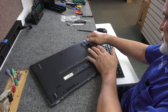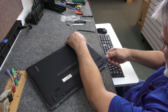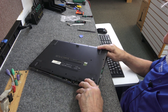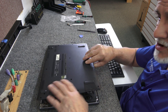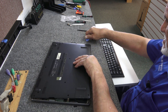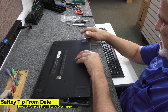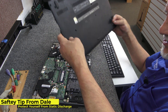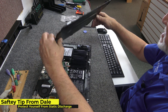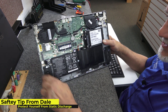Once we get it started, it should pull up without too much trouble. I had actually had this laptop open not too long ago before they broke it — put a new solid state drive in it. It should just wiggle up here. Don't want to force it though. Be careful poking in there — you got speakers on each side. You can see it comes right off, not too much difficulty. Like I said, you got speakers here, so be careful of that.